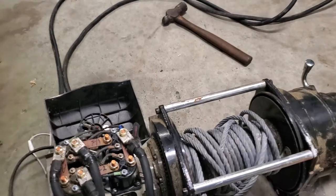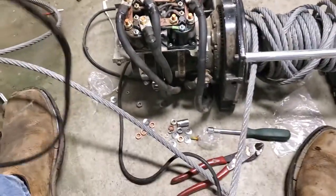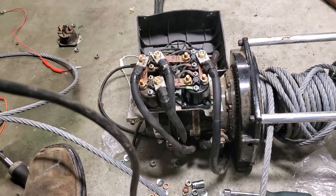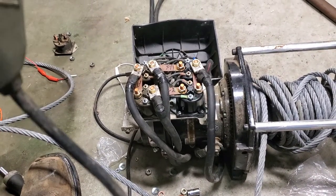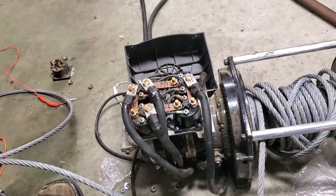Anyway, so he let me hook the leads up, touch them to the battery terminals on the truck that I drove over there, and I noticed that it wouldn't spool out. It would spool in under power, but it wouldn't spool out, and I thought maybe a contact was froze up or something. So I took it and I jumped it off the tractor here so I could test it, and tapped on the motor a little bit, and that didn't do it. So finally I got to researching, and everybody suggested that it's solenoids. So I tested the solenoids and found two bad solenoids,